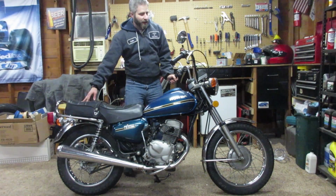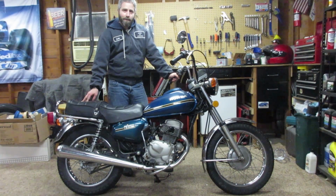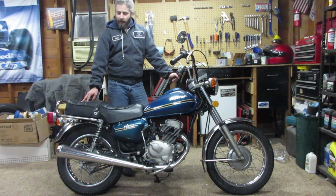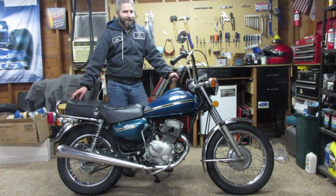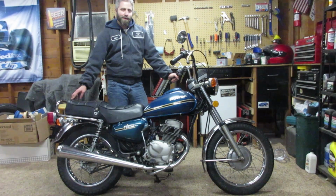Okay, I'm going to end this video here. The good news is the bike powers up, it turns over. I can definitely smell a little fuel coming through the engine, and it definitely sounds like I've got spark. So all of the necessary functions are in order, but I think it's just a little too cold out here today. It's probably just over 40 out here in the garage, and I know for a fact it's in the teens outside with some pretty high winds. So I'm thinking this bike's just going to fight me as long as it's this cold out here.